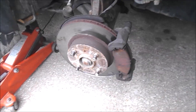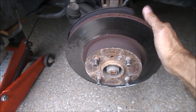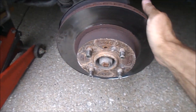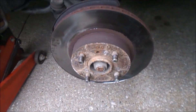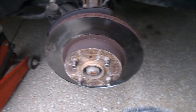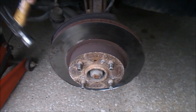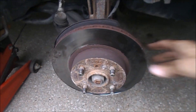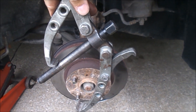Once it's exposed like this, if it was brand new it would just pull off — you just kind of wiggle it. But at this point it's got a little bit of rust in there. Just going to take a hammer and tap on it. If it doesn't come loose, which mine isn't, then you've got to attack it with the old puller.